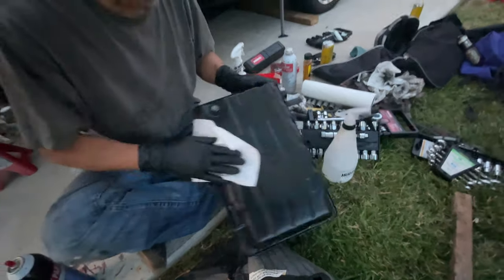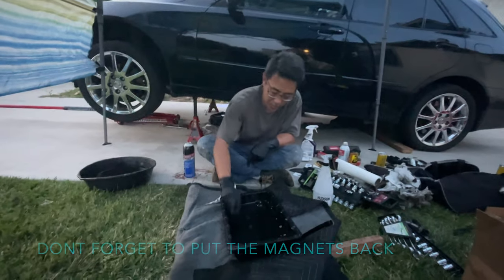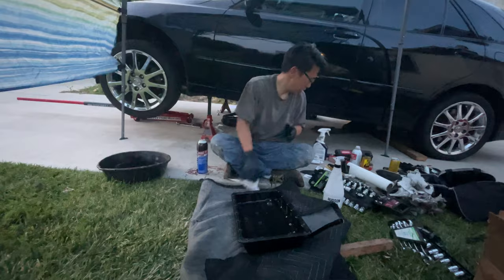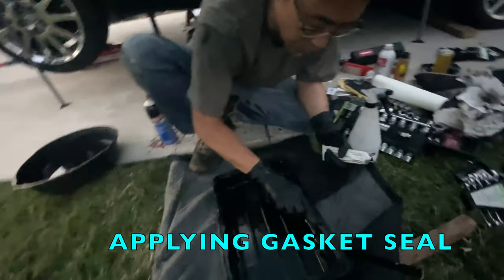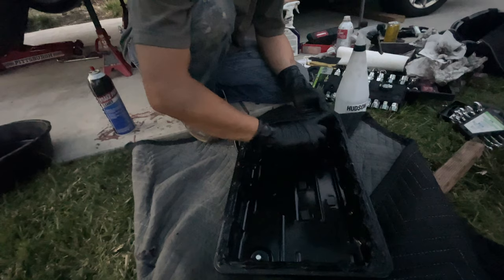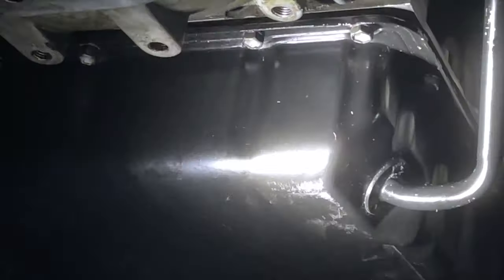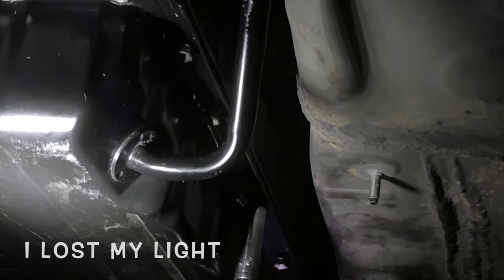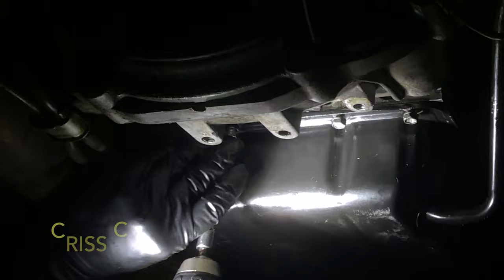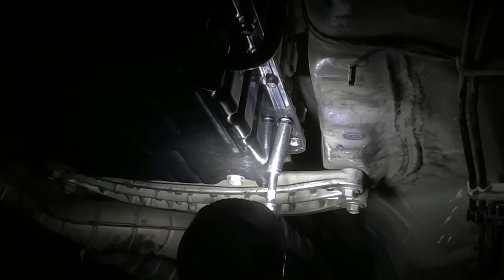That is perfect. Watch out — this way they went. Now I'm just going to apply it all the way around and then smear it. I'll wipe down the outside and wipe down on the inside. What that does is it distributes it down the lips. Once I smear it, it has to be put on and applied for 15 minutes. Now it's lined up. I'm seeing some squeeze out, which is a good sign. Going in a criss-cross pattern working from the outside to the inside.